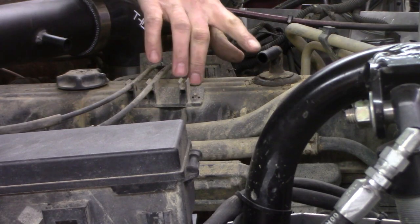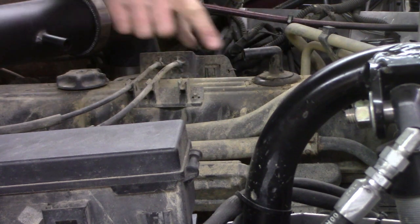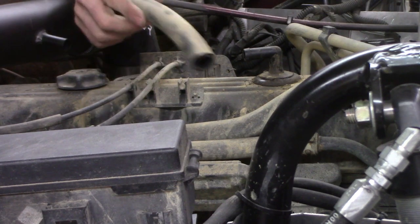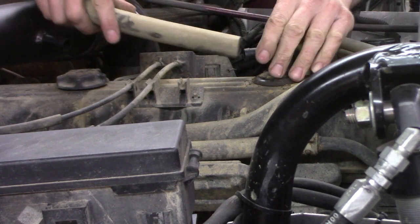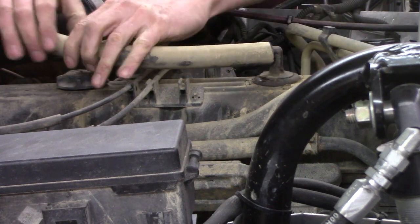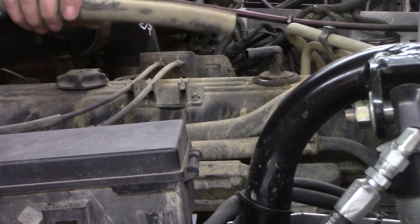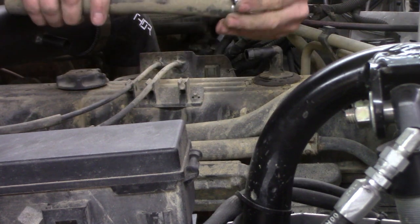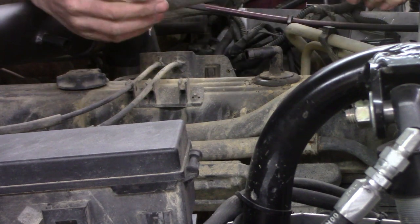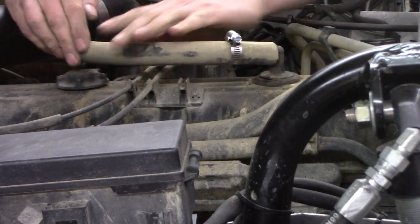The last thing we need to do is hook up the PCV valve. The hose that was on there kind of went like a little elbow and obviously it's not long enough, so you have to get a piece of hose. I have this piece just laying around the garage — it'll work. But for a few bucks you can go get a piece of hose. Make sure you put hose clamps on it before you try to install it — they're nothing, just a couple bucks.